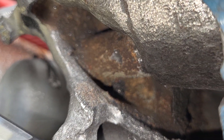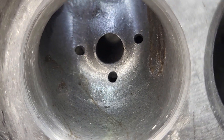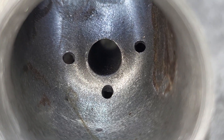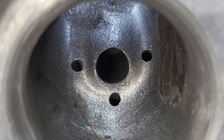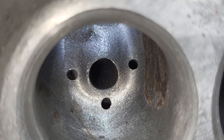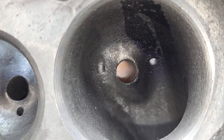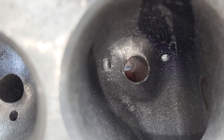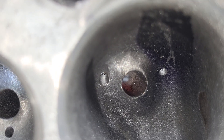I cut this open so I could get some measurements from this side. Notice how flat that bowl is — so if you want to give it a better, more aerodynamic shape, you're going to be pushing your luck. So I drilled some holes so I can actually see the thickness. I did go back and pushed my luck a little bit on the ones going to be running on DV's Mission Impossible. Take a look at this — the left side of that hole could be brought out a lot deeper, but look how thin the one on the right is.